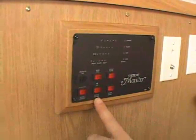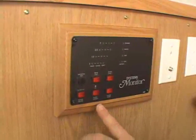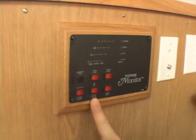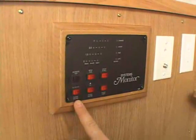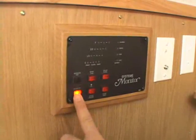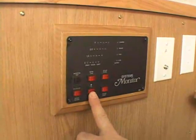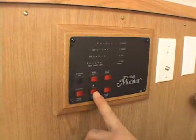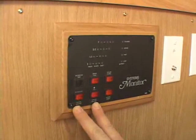On the bottom row you have two buttons marked water heater, because the water heater in the classic models is equipped with both a 110 volt heating mode and an LP gas heating mode with direct spark ignition. To turn your water heater on 110 volt, simply turn the switch to the left and the elements will begin to heat. To heat on LP gas mode, turn that switch to the left as well; the light will come on and eventually go off once it's lit. It is permissible to use both modes at the same time for faster recovery time.